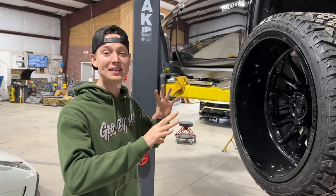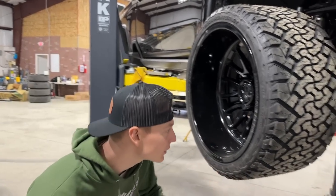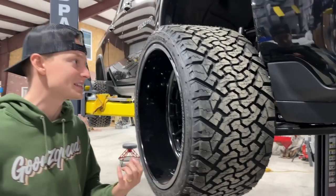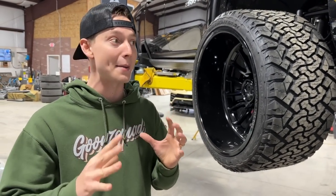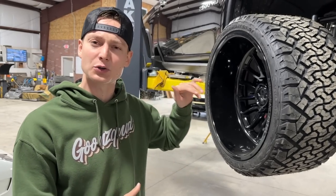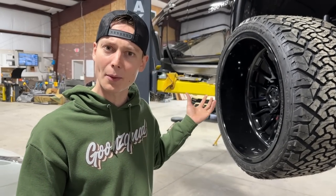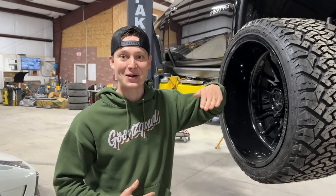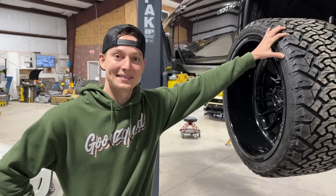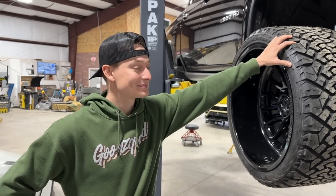Overall, everything has been pretty smooth with the lift kit. If you look underneath, we got some pretty crazy stuff installed there. This is one of the best lift kits, I think, for this truck, so we're super happy to finally test it out. Previously, we didn't install the torsion bars or the torsion key properly or something, so right now it's literally just nose diving, dude. I think we're gonna have to pull them out. Hopefully, we don't have to take off too much. I think we gotta re-torsion them.